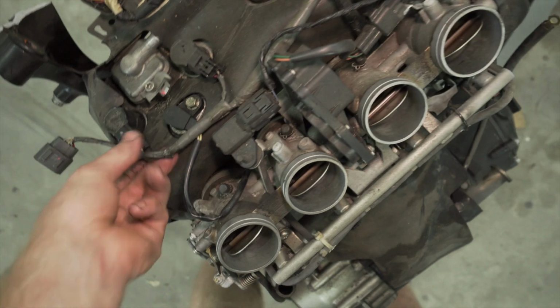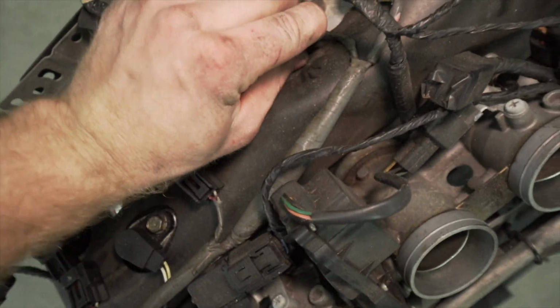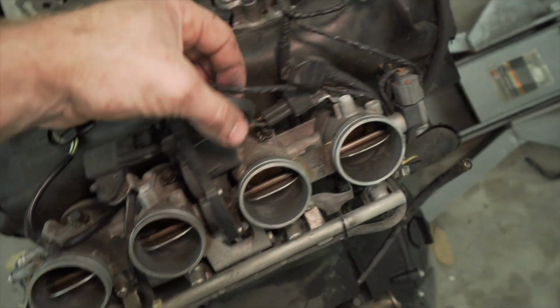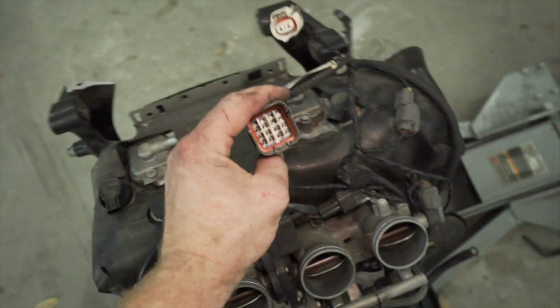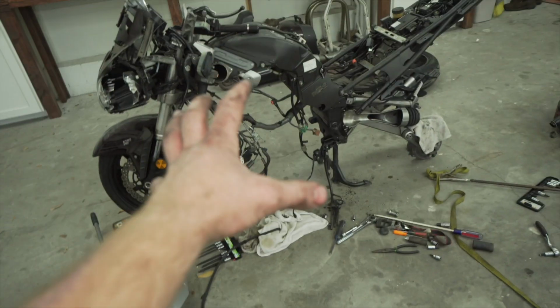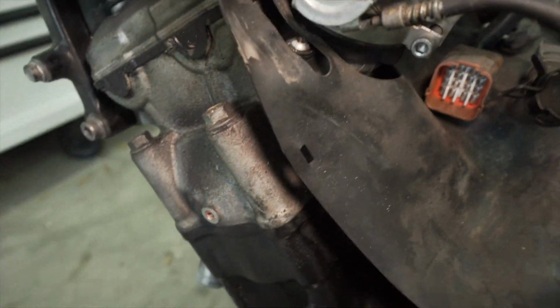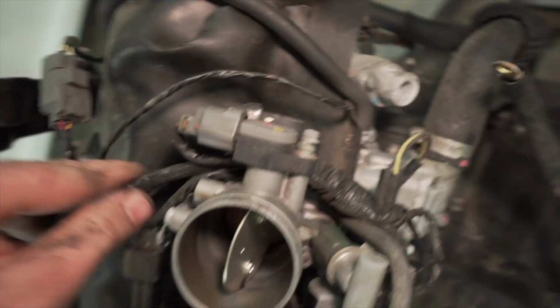We got this plug. Gonna pull all the spark plugs out. The coil packs out, excuse me. That wiring harness. Gonna pull the throttle body off in a second. Don't have to take many wires with it, I think. The nice thing is these got some big plugs, so you can assemble everything up here and then put the motor in place and just plug in the large plugs, which is nice. This puppy is coming off here. I'm not putting this back on because this bike is gonna be naked, so this thing is ugly. There's this plug down here. This goes and powers, I don't even, oh, it plugs up all into the throttle body. But I am gonna disassemble everything and then throw this puppy up on the welding table over there.